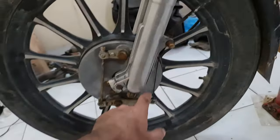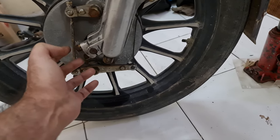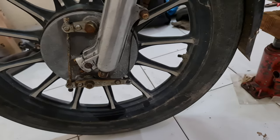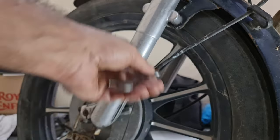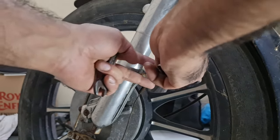The plan of action: first, open this and loosen it up, then get the wire out, then open or at least loosen these, then remove the front wheel and get the hub out — I'll show how it's done, same on that side. Let's proceed. Okay, so let's begin — 10mm for this, 12mm for the bottom.